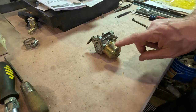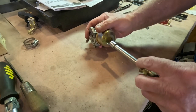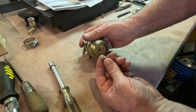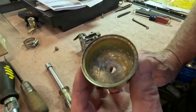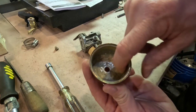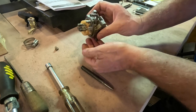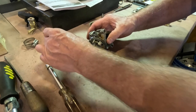I told you I would pull this apart — this is the old carburetor from the log splitter. Take this bolt out of the bottom and if you look, you can see how much crud is built up in the bottom here. This is just leftover corrosion. The float — just so it's not flopping around in our way — take that off and put that aside.